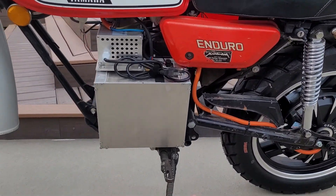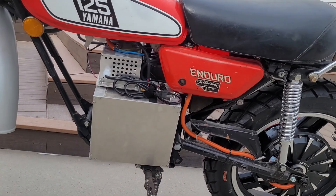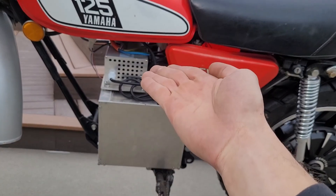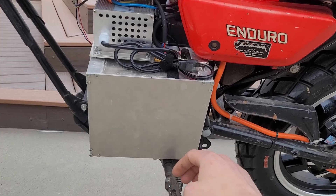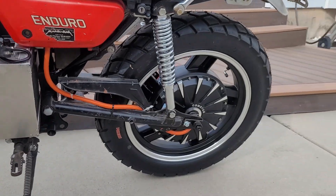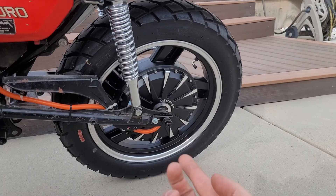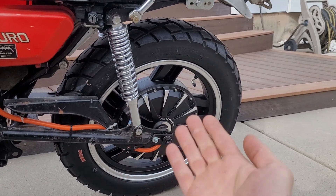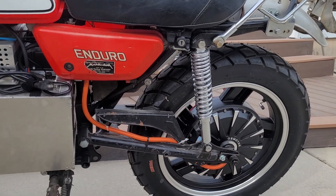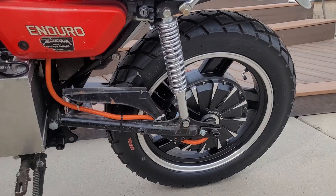I went with the hub option because there's a trapezoidal-shaped area here, and if I put a motor there I would have almost no room for batteries, and the heaviest component would be up off the ground raising the center of gravity. So this allowed me to have all this space for batteries. The downside is now I have a 40 pound hub that's unsprung mass with the suspension, so it does ride rough off-road — which you probably wouldn't want to do with an electric motorcycle anyway due to puddles and stuff. So this is now mainly a street bike.